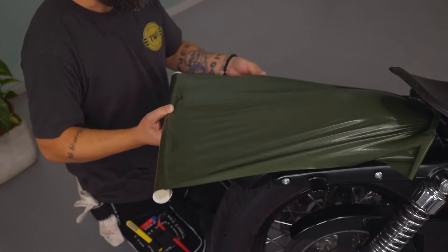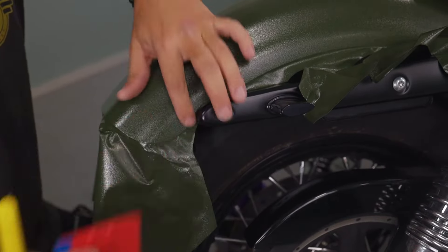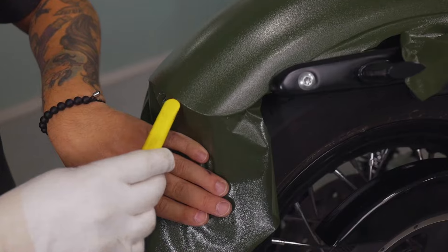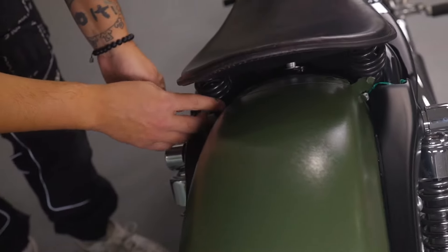On the back section, which is a little curvier, keep the backing paper on to even out the stretch. Tuck the material behind any raised objects, heat the film so it shrinks on the edge for that extra long-term hold, then cut the excess film away with the blade angled out from the edge. For any sections where the material will be directly cut on the surface, use 3M knifeless tape.